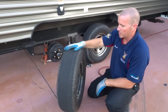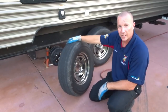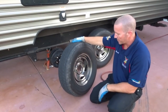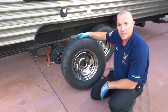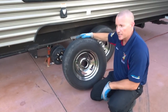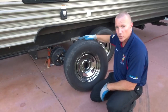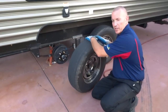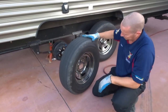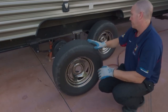After inspecting my own tires, they've made a believer out of me. I would say if you have these tires on your trailer, at the very least you should check them out and look them over very thoroughly before every trip. Run your hand around the tire and make sure you don't feel any humps where a belt might be starting to separate. Like I said, we'll get the Carlisles on and show what those look like.